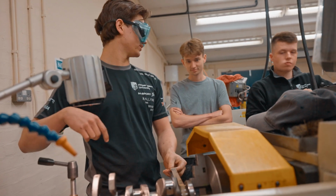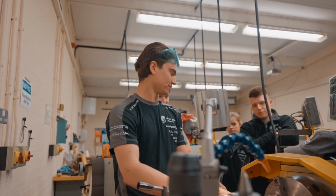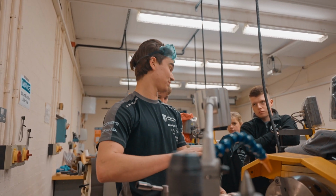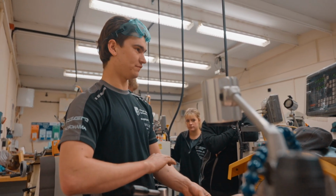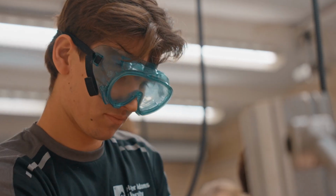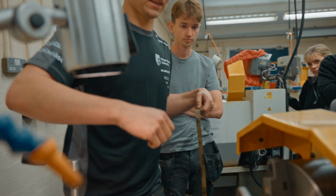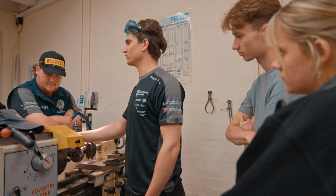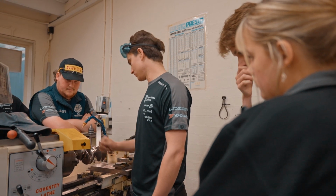So you know that roughly you want to go engine rotation, which is that way. You're going backwards and forwards at a sort of medium-ish pace, trying to match what the lathe's doing. Often start with about 15 to 20 seconds and then look at your journal. Probably a bit more, maybe another 10 seconds on that one, and then we'll call it quits. It's not going to pick up. That's okay, that's basically what we're aiming to do, just smoothing it out.